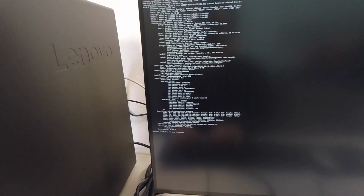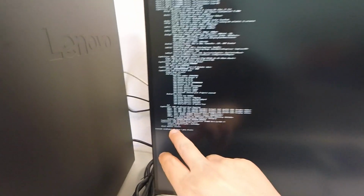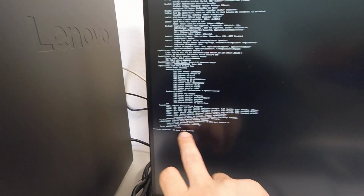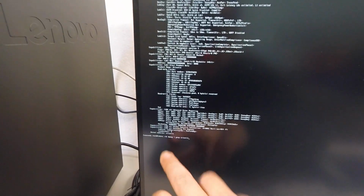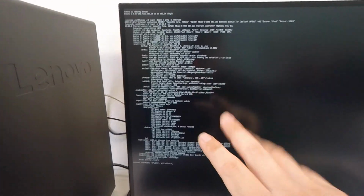Let's look at the kernel messages for Atlantic. Because it looks like the kernel module... well, it does not say kernel module in use. So it's identified the kernel module that it should be using for this, which means that the kernel has a network driver for this card, but it's not loading correctly, which explains why the network interface is not available.